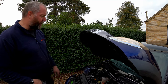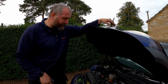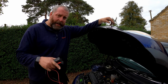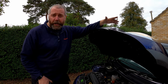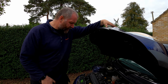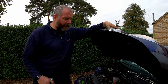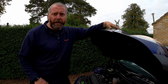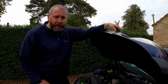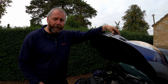The engine is running, belt routing looks all good, everything seems to be working fine and the alternator is spinning. I've turned the headlights and main beam on. Checking across the battery — I'd expect to see around 14 volts; 13.5 would be suitable. We've got 14.14 volts — she's charging fine and running absolutely beautifully. We've cured the problem: the alternator had failed and wasn't charging the battery, and we've rectified that. I'll let it idle up to temperature to put a bit of charge back. The car is now back in action. Hopefully you enjoyed this video and found it useful — leave a comment if you used it to replace your alternator and it saved you some cash.